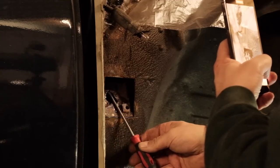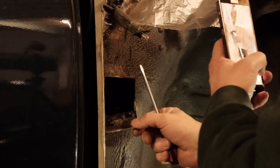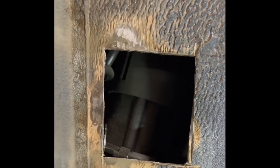And while the magic of a chemical reaction was taking place, I repaired the next rust spot using the usual butt welding process that you know from my channel. I made a special effort to get gaps even tighter as usual to make sure that the area behind won't be harmed by weld splashes.